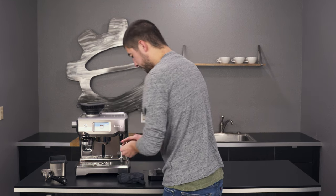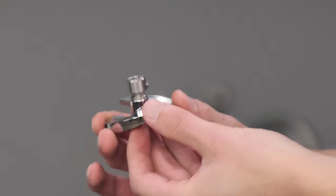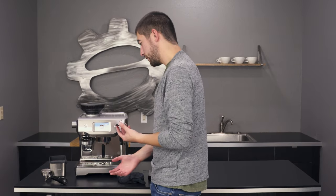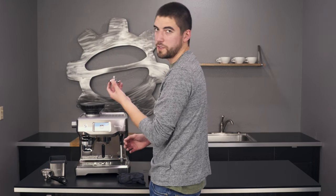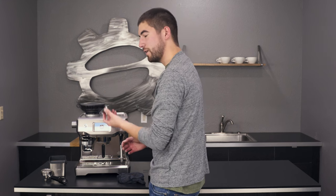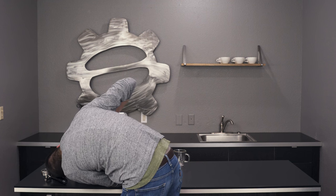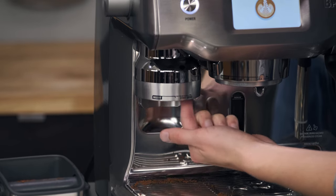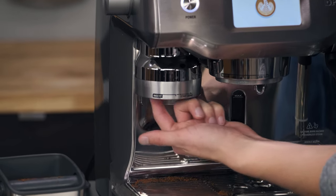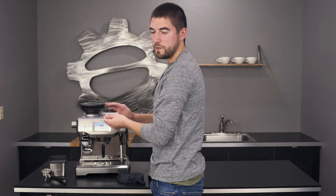I'm just going to give this tamper fan a wipe and then place the square portion back into the top of the tamper fan. It can be a little bit tricky to do this - if you're having difficulty, you're probably going to want to pull out the drip tray and take a look underneath because there is a shaft that this goes up onto, and that's what you're going to be screwing it back onto. It's harder to get it back on than it is to get it off. Once you've got it threaded on there, just go clockwise until you feel it to be tight - about 10 to 12 turns clockwise. You'll feel it kind of spring back against you, and that's when you know it's ready.